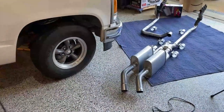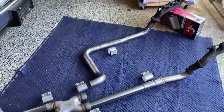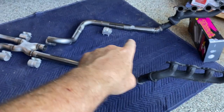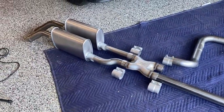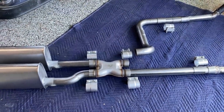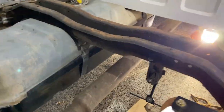I've been working on it for the better part of almost two days and I pretty much got it together. I just pulled it out so I could assemble it as a unit and show how it's going to look. I still need to weld it all together — the various components up by the exhaust manifolds are fully welded; the lower parts are just tacked into place to hold their shape so I can take them off and put a full weld. The areas where you see clamps is where I'm going to use a clamp to give the whole system a little flexibility so it's not so rigid.